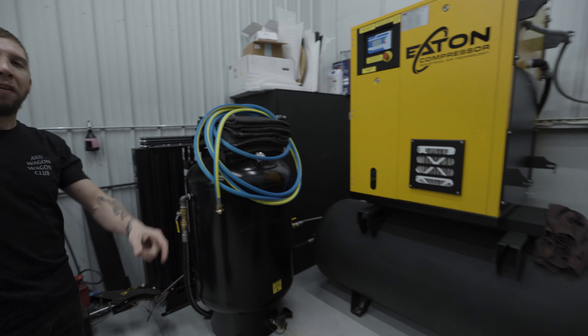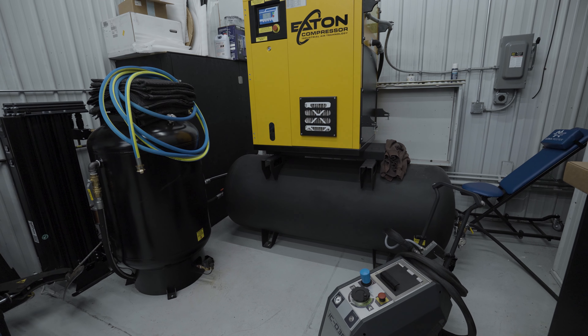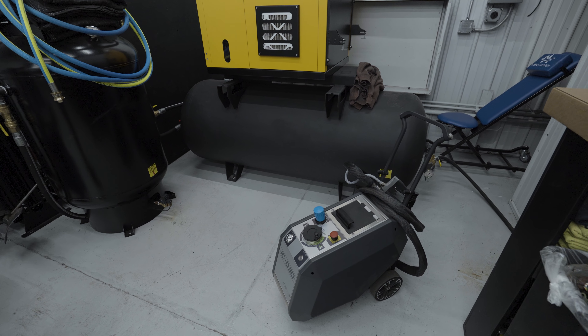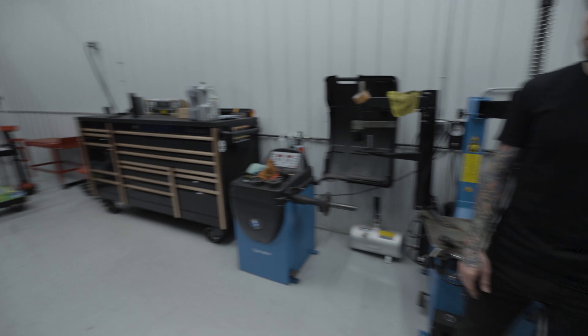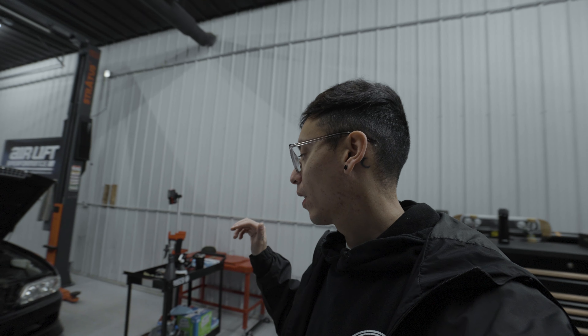It's kind of shocking what you need to run this little machine — this compressor setup is really on the smaller side, bare minimum. They eventually want to get two compressors and a bigger tank. But for what you want to do with the engine bay, it'll work perfect. Another thing with dry ice blasting on engine bays is that you have to let the engine cool first — the ice is cold, so you don't want to risk any thermal shock or harm. But pretty much it's ready to get started.